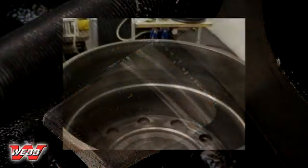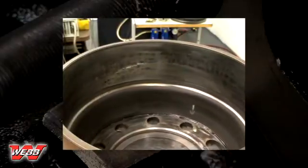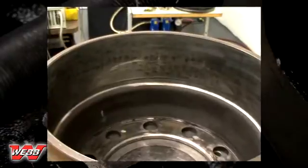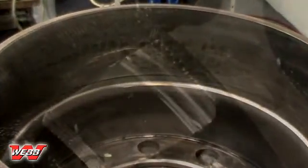Operating with a misinstalled brake drum causes the braking surface to wear unevenly and leads to localized heat checking or blue spotting as shown here. Continued operation in this manner drastically reduces performance and can lead to drum failure.